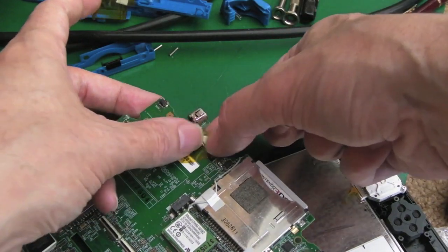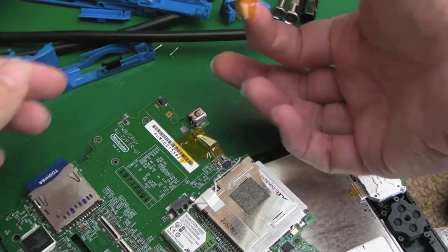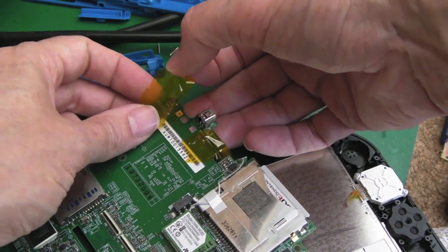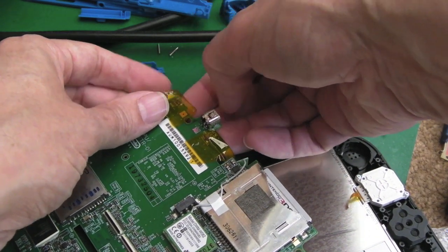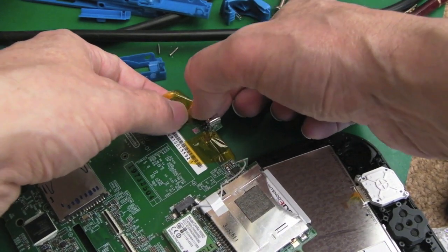We'll stick that over there. This is just heat proofing tape, so it stops some of the heat getting through to certain areas. If you've got plastic parts like that switch there, you might want to make sure that's fairly well covered. You could ripple it out. What I mean by ripple it out is stick it down there, loosely couple it. So can you see? We've got a big bubbly sort of cage around it. Maybe pinch it a bit here, stop the hot air getting in.